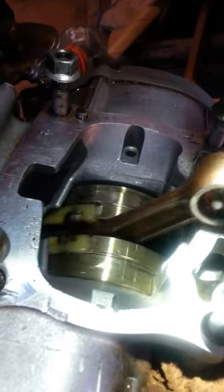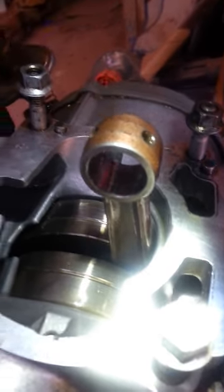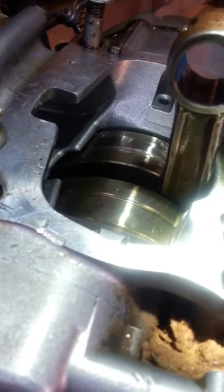You're going to want to spin the crank, and wherever you spin it, the oil you put in there should bring all the debris out through the back or out through here. You want to stick a rag right here and keep spinning it until the oil covers the rag. All the debris should come out onto the rag and it will catch whatever debris you have at the bottom of the crankshaft.